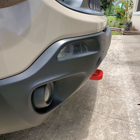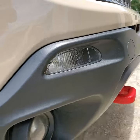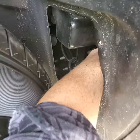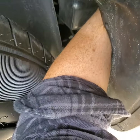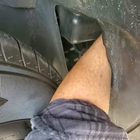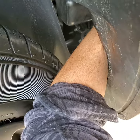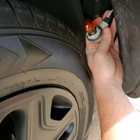The next step is to get hold of the blinker bulb that is in with the daytime running lights in this particular location. Come around to the hole that we've just opened up, reach in — you're feeling for the back of a light. Follow the wires up and you'll feel the back of the light; it kind of has a handle shape to it. Twist it to the right — in this case because we're on the passenger side — and it will come out, and then you'll have your bulb.